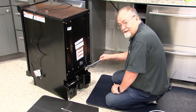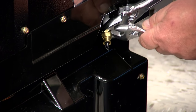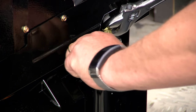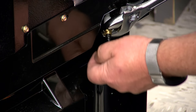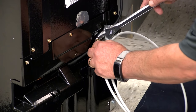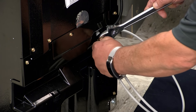The first thing we're going to do when we connect the water line is take the cap off that's installed on the product as it came from the factory. We'll use a backing wrench so we don't twist the line inside, and adjust the wrench to fit correctly. Loosen it and remove it. Now we have our water supply line — we're going to connect it. Make sure it's nice and square before you start tightening it. If it starts very hard, it's cross-threaded; if it's nice and easy, you're all set. In a couple of turns it'll start tightening up.